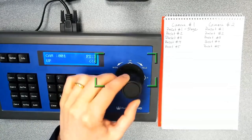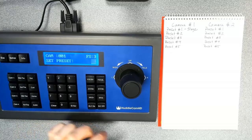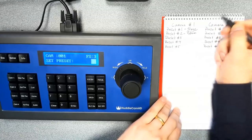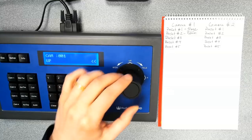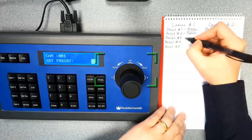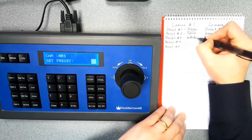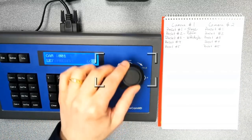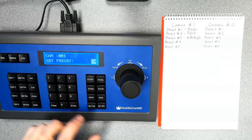What you can do is pan, tilt, zoom the camera to another location, hit set, then hit 2 and then enter. Now number 2 has been saved as your next preset. Just go through this process while setting up a shot - get up the angles, make sure you have a monitor so you can see the camera really well and see where you're setting it. It's very easy to set up hundreds of presets. You set up a stage, a podium, maybe a wide angle shot, and you can just pan, tilt the camera exactly where you want it, hit the number and then set.